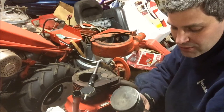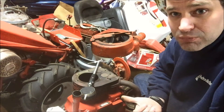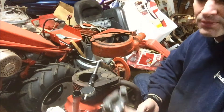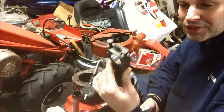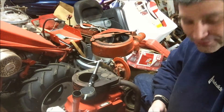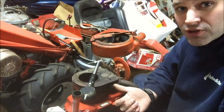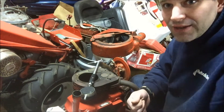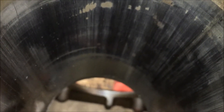This is the block that had the grenade balance gears — if you remember, there was a broken dipper on the rod because the balance gear fell in the oil pan and broke the dipper. Shortly thereafter the thing seized up solid and wouldn't even turn, and it scored the cylinder pretty deep. We'll see if we can get some pictures of that so you can see the scoring.